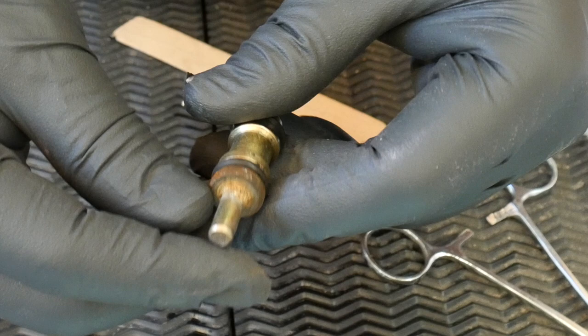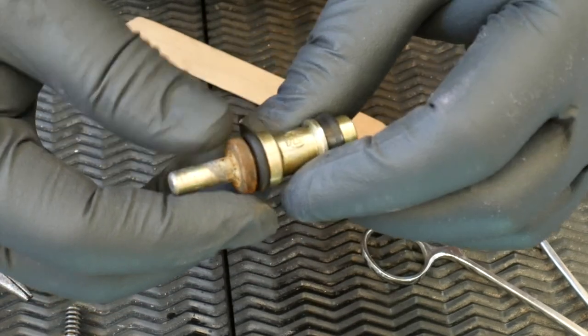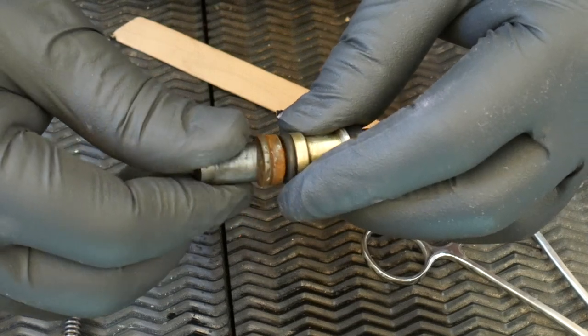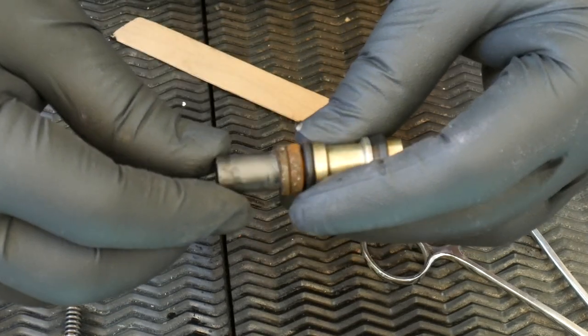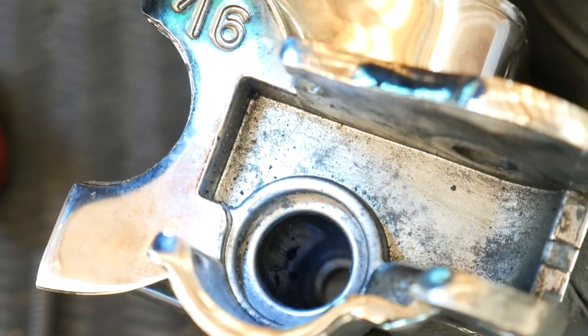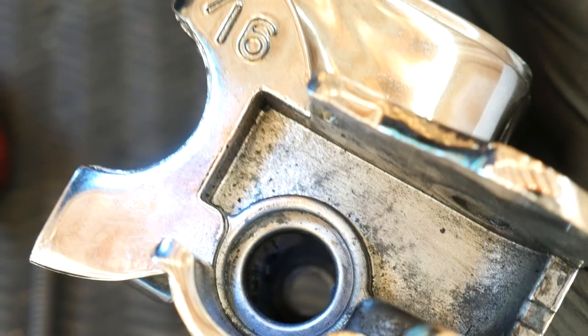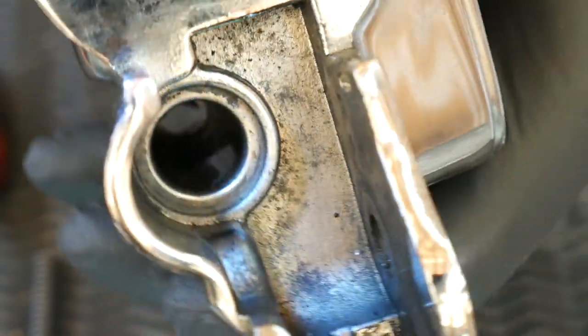The piston is some sort of cast metal alloy that has seen better days. The dust cap goes on top of it. We also have to check out the cylinder bore — make sure it's not rusted or scratched. Don't poke inside it with a metal brush or metal object; just give it a good clean with a clean paper towel and you're good to go.